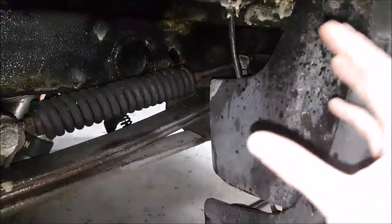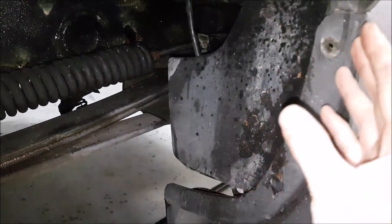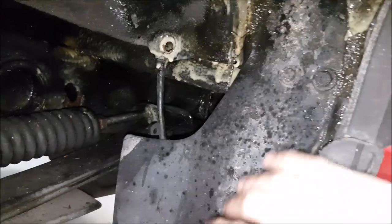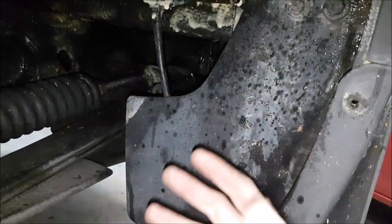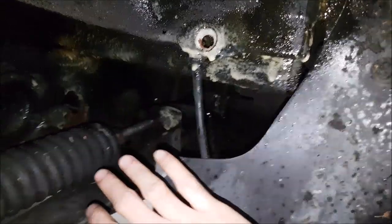Why do you want to have some sort of inner fender liner? Years ago I noticed that when I was driving in the snow, my truck would just kick up stuff all over the place. The problem is you see a lot of trucks start to rust in areas like this because they're kicking up salt and snow, just eating away at the metal. So what I did was I got some mud flaps — that helps stop a majority of the crap throwing to the back of the truck. However, you can see here I still have a lot of openings. I also put one in the front because stuff is being flung up front as well.